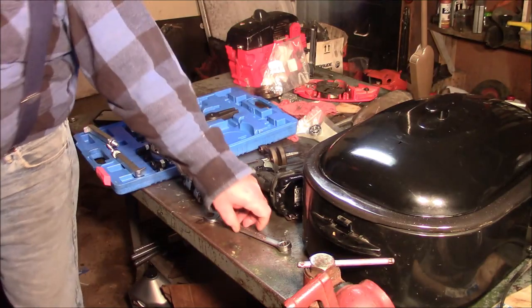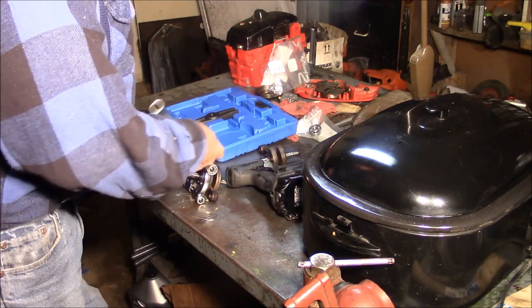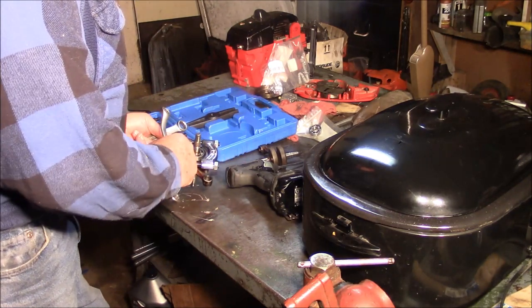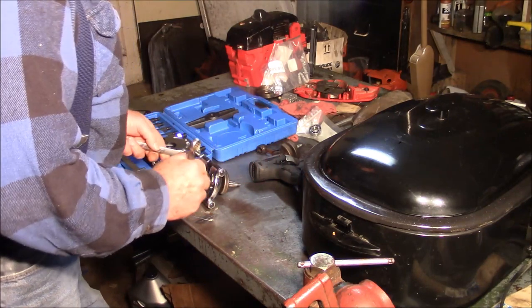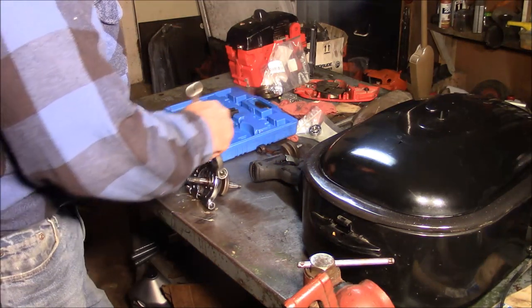Couple of unusual shop operations, I think. One is peeling a bearing off a crank. And the theoretical types will come up with a gazillion reasons why this doesn't work, but let's just see what happens. Basically what I've got here is a bearing puller, and I put the knife edge behind the bearing, and then I crank down on the thing, get a good bite, and then take a puller and just try to pull that bearing right off the crankshaft.